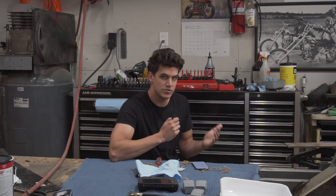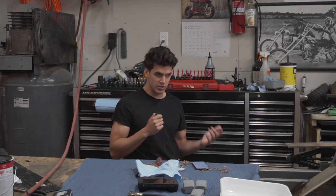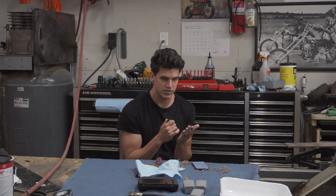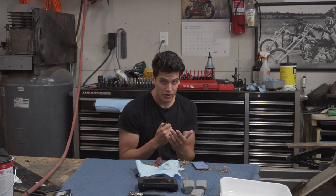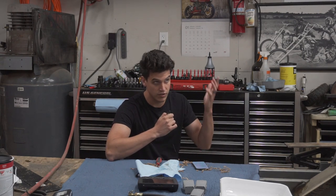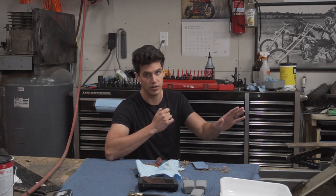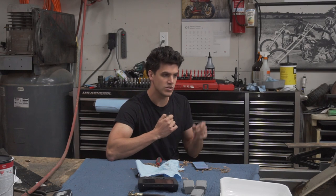In this video, I'm going to swap the main jet on my super cheap Amazon carburetor for the Predator 212 Harbor Freight Motor go-kart. My hope is to have a little bit better throttle response when I slam on the gas. The way I drive my go-kart, it's really just full throttle or no throttle. What we're going to be doing today is the main jet, which is where most of the fuel comes from, and when you change the main jet, it has the biggest effect at full throttle. I'm going to go up one size and see what kind of throttle response I get.